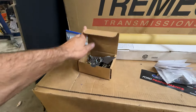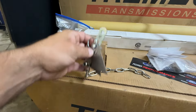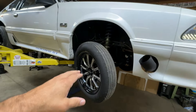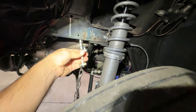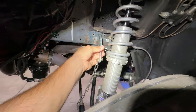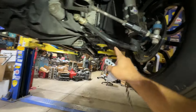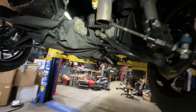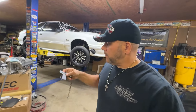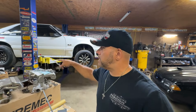What we were going to install today was we were going to start taking travel out of our white car. These are the Team Z travel limiters. We've got about six and a half to seven inches of travel that we actually leave on the line, and that's really cool for some no prep. We've done pretty well with the car. We had been getting ready to install travel limiters - it's basically just a bracket and some chain welded to your frame rail, and there's another little gusset that you can weld to the control arm. It limits the travel of the strut. This is a must when you're doing a lot of racing, especially when you have a unique suspension setup like we have on the white car. We were pulling about three inches of travel out of it to start - we could probably pick up some ET with that.